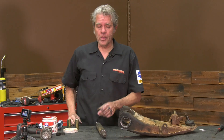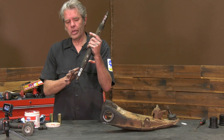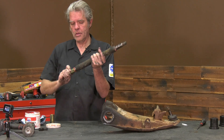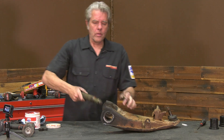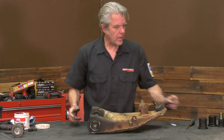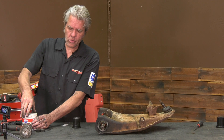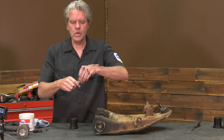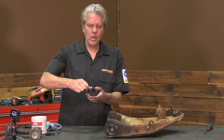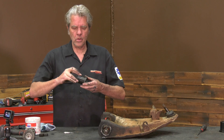Now let's go ahead and put everything back together. I'm going to get some thick grease — wheel bearing grease — and put it on the shafts here on either side. Then I'll slip these on and go ahead and install it in the shaft here on the lower control arm. Then we can go ahead and install urethane bushings here. This is kind of like a metal grease. For metal on metal this grease right here comes in your kit — it is more specific for the urethane. So we're going to open this up and get a pretty reasonable amount on the outside and on the inside.